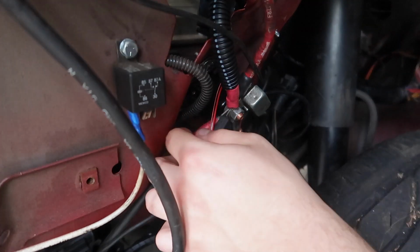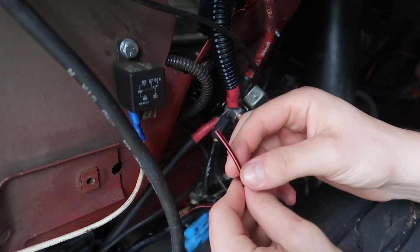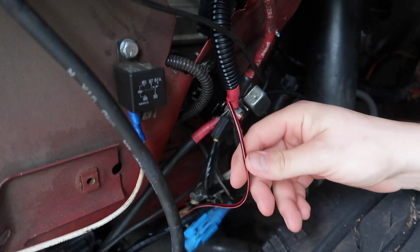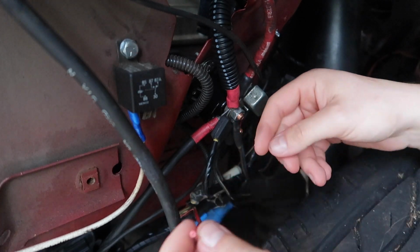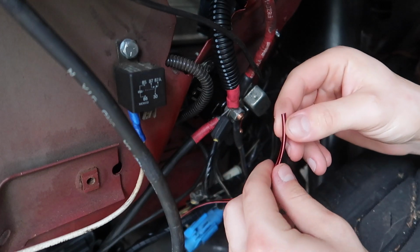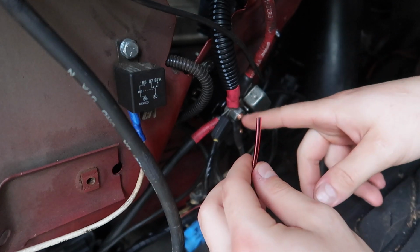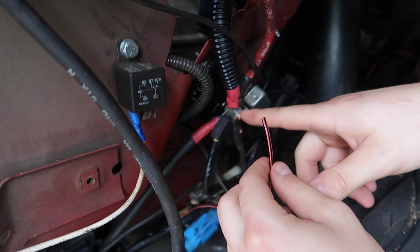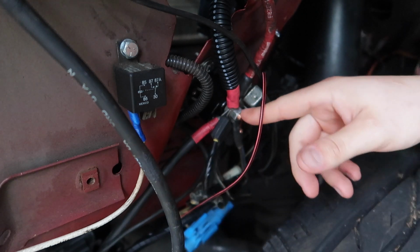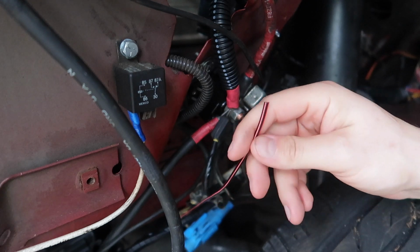What's up, guys? So tapping in, this is the wire that I fixed for the alternator so that it can start charging the system now. My terminal connectors came in, so all I'm gonna do is open this up, splice into it, hook up the terminal connector, hook it onto the positive post right here on the starter relay, and see where we go from there. I mean, this is gonna be done for this part.